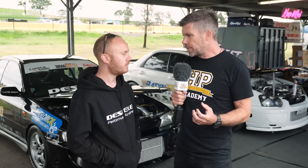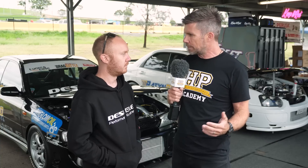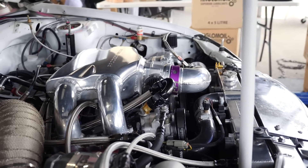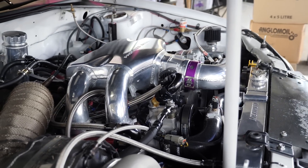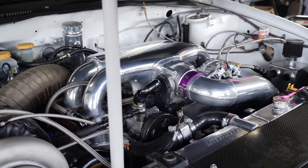The narrow bearing is one issue, but there are other areas that go hand in hand — it's not a one-size-fits-all fix. Most people would be aware that on a race track with high lateral G-force, the factory sump can be a problem and you're not getting oil to the oil pump. For drag racing and roll racing it's fine, but if you're going around a circuit it definitely becomes a problem, mainly under braking.